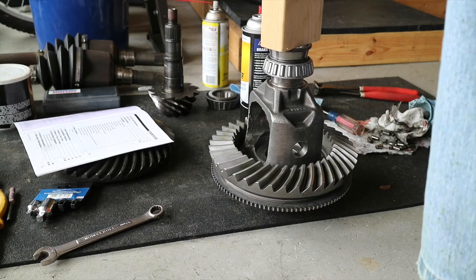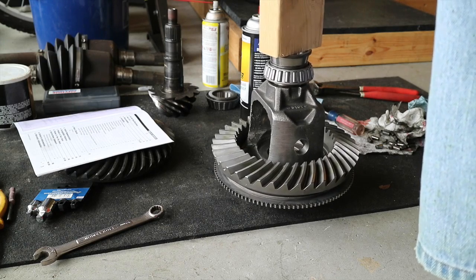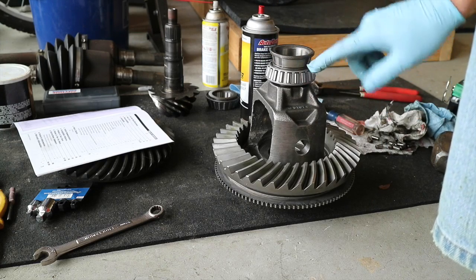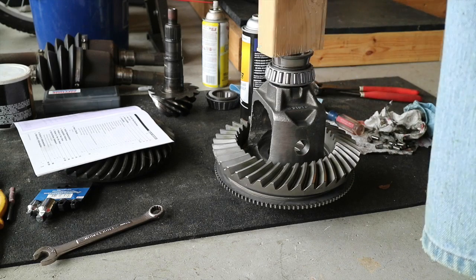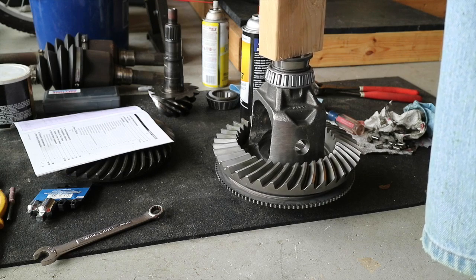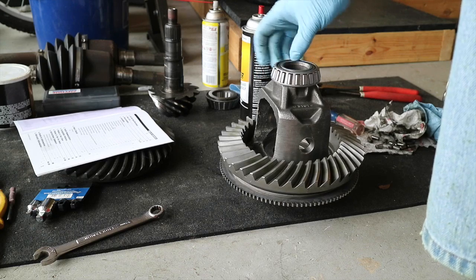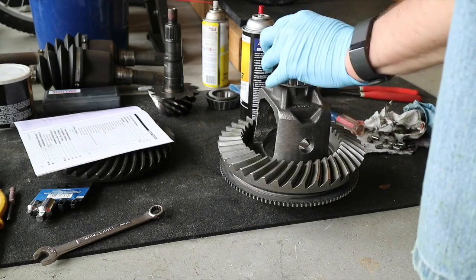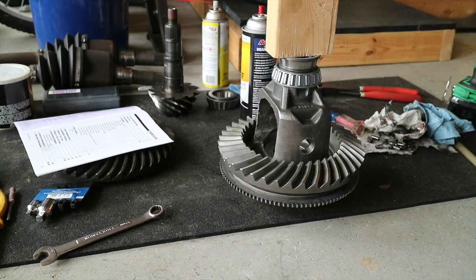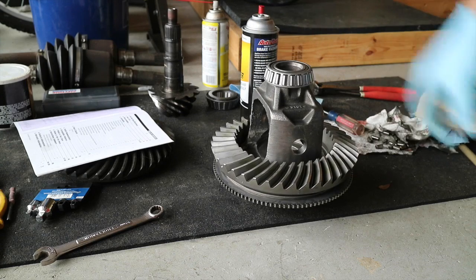Line everything up beautifully, give it a good whack, and it'll start to seat. We're nearing the top of the post, very close to being done. When it fully seats I'll know because this will start to hop. You can feel the crown - it's actually sticking out of the bearing race. Give that one more good solid strike just to make sure. You can see this doesn't want to move off because the post is sitting proud - it's hopping good.